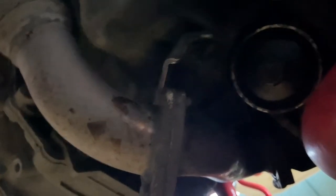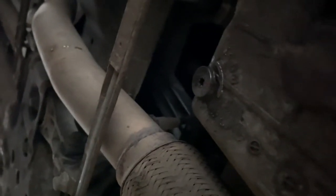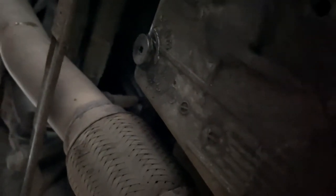I'll show you under here. Where your oil filter is, every time you change it, just try to clean around here and all the areas that can get oil drips on — like where the exhaust is and stuff like that. Because when you put the oil in and let the car run, you'll be able to see if there's any leaks coming from anywhere. Same with the sump plug as well — just tighten it up and clean around it, so when you start it up you'll be able to check for leaks.